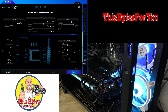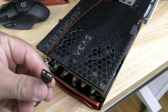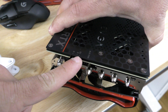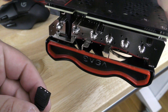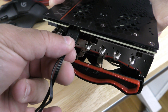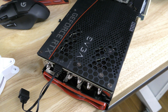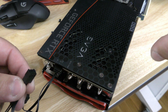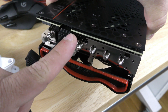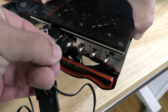I'll go ahead and show you the headers — disconnecting and then now connecting them. The ARGB header: these three little pins right over here are going to connect right here — 5V, D, and G. You can see the pins right in there, so just slide them in. For the fan that also comes with the card, there's the 3-pin header, and we're going to connect that to the aux fan port. You can see those pins right down there.